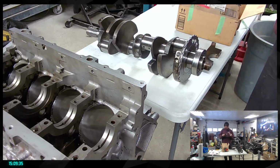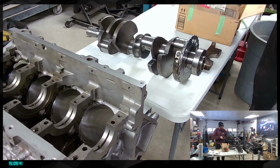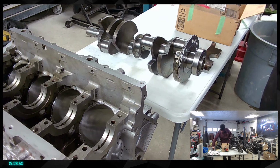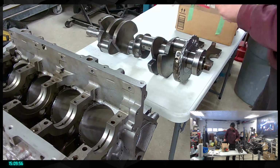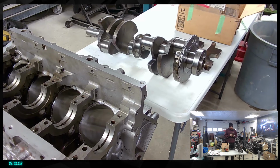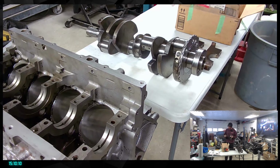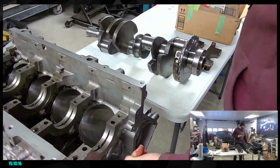So who was saying it will not take that long this morning to make maybe the engine assembly? Oh yeah, me, yikes. When I tore apart that engine, actually when I removed it from the car, when we removed the oil plug, it was a magnetic oil plug, and there was quite a bit of metal on it, enough to get me a bit worried. And honestly, in the end, it's not that bad, because it actually was some bearing material from the camshaft.